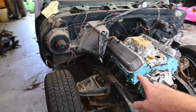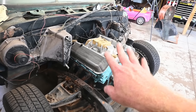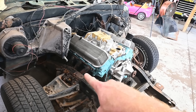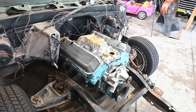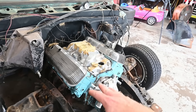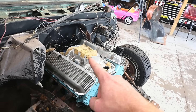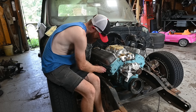One of the first things I'm going to do before we get too deep into getting everything ready for the engine is slip this header off on the passenger side and drill it for an AFR gauge. Once we get this thing powered up and broken in, we'll be able to hook an AFR gauge up and help tune this thing. I've currently just got it in mock-up mode.